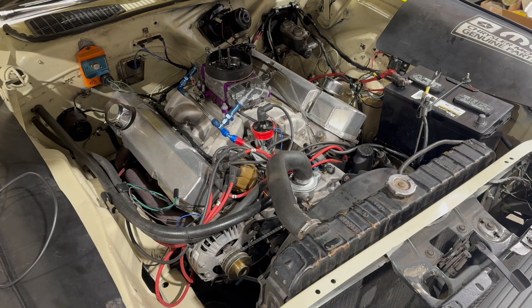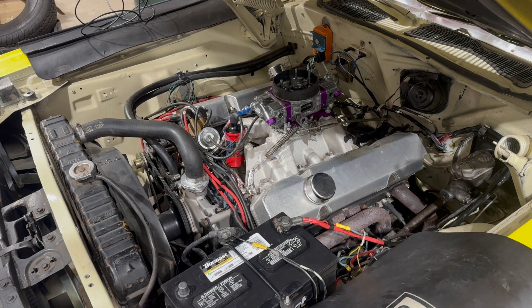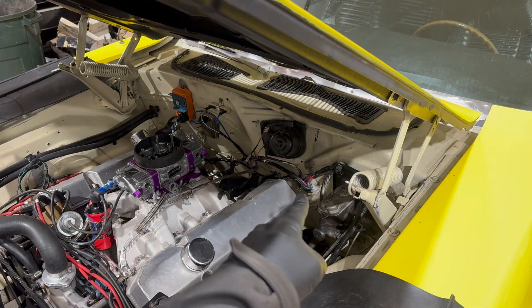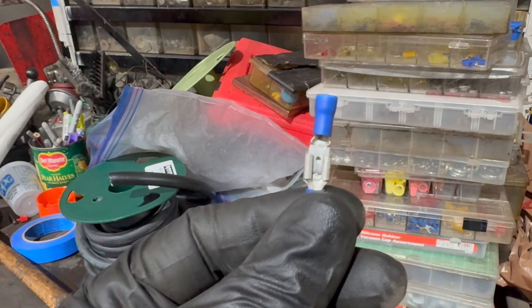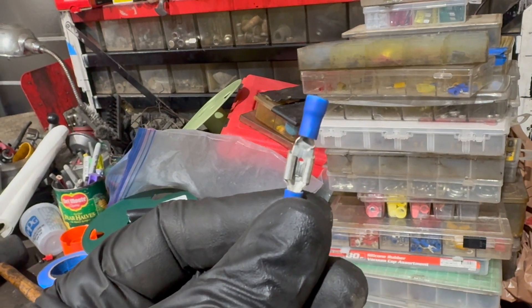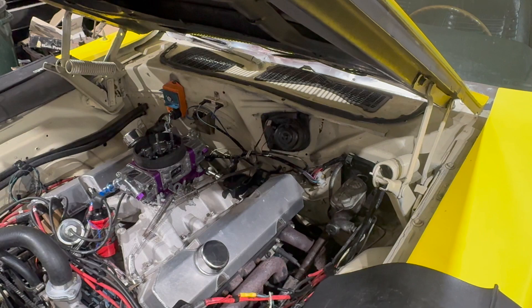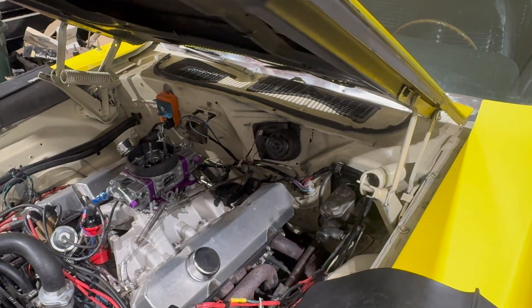If you ask a four-year-old to draw a simple circuit from an alternator to a battery, they'll probably just draw a straight line — and that would make great sense. But in these cars, that's not how it works. The output stud of the alternator is actually connected to a wire that goes through that bulkhead connector. The terminals in the bulkhead connectors are essentially spades, just like this. You don't exactly have to be an electrical engineer to look at this and think that is a little bit of an underwhelming connection to run the entire electrical system in my car off of. And this is a pair of brand new connectors. By the time they're 50 years old and they've been carrying all that amperage for years, they've heated up many times, they've corroded, and sometimes they've gone into full meltdown.